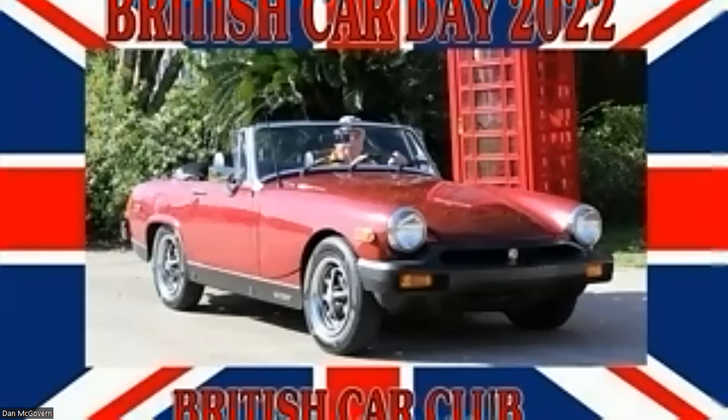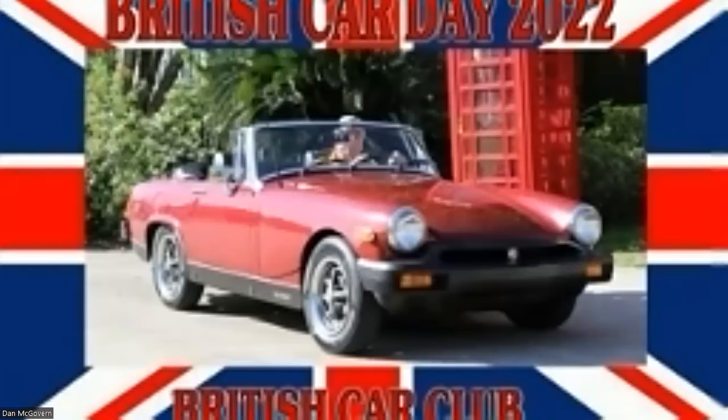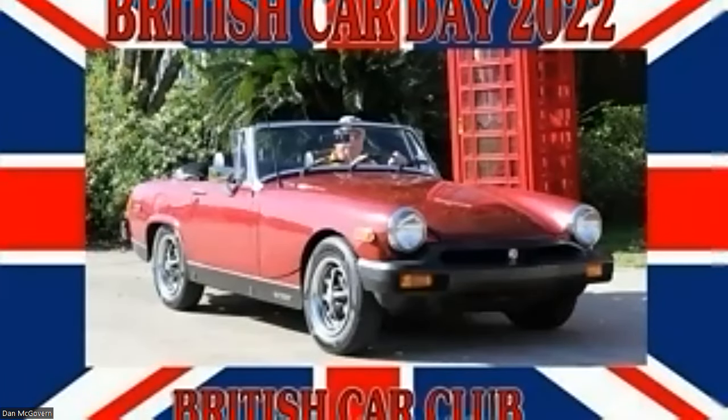Amazing. So John, just to bypass the rheostat, I just literally reconnect the wires according to their colors. I recommend a fuse, because the dash lights are not fused. It's extremely rare to have a problem in there. But that's why I said wrap the connection with some tape.